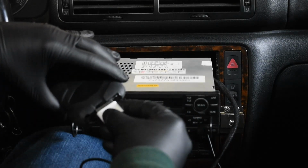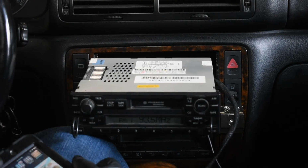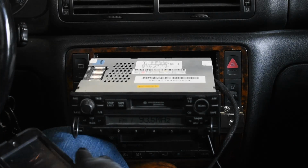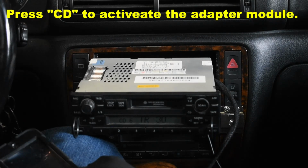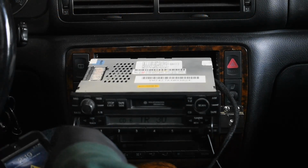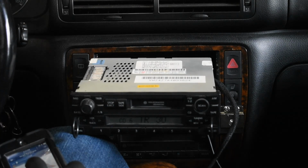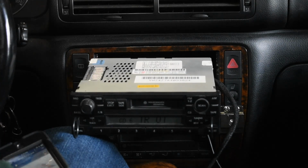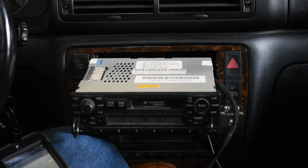I am testing the system with an iPod Touch 4th generation. It displayed the charging not supported with this accessory message. This adapter is meant for the early iPods, which charge via FireWire. Newer iPods only charge via USB. Adapters are available that convert the FireWire 12V to a USB 5V. All the data functionality will work: music, podcasts, etc.